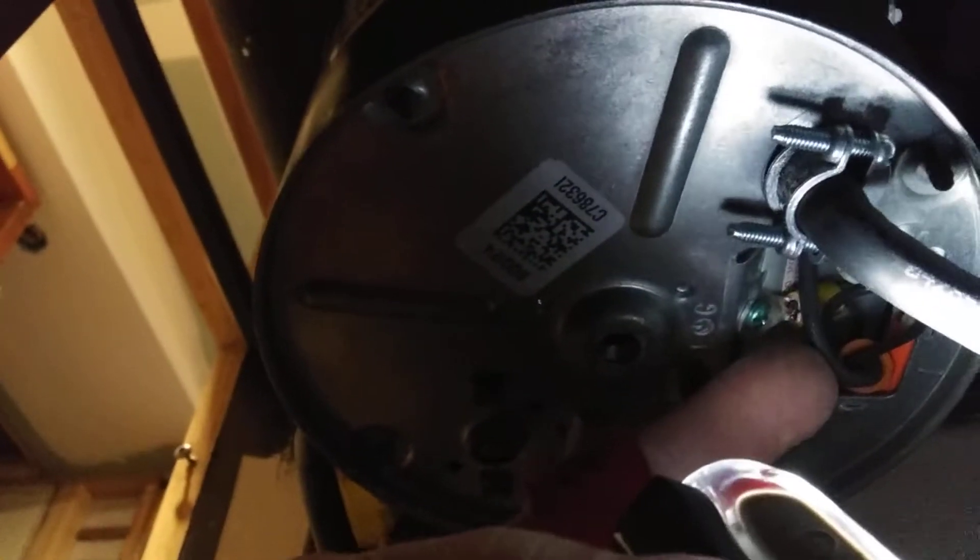Here's how to wire it. This thing comes from the factory — I've left the cover off. This is what the bottom of the disposal looks like. There's a little plate that comes off, and it has a knockout hole where you can screw in a clamp. This has to go to a switch circuit — this is power coming into the disposal, 120 volts. That black line going into it is nothing more than a tube. This is a pneumatic switch — there's no electricity in this thing.